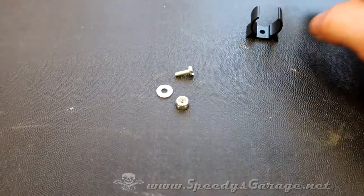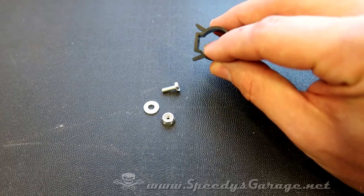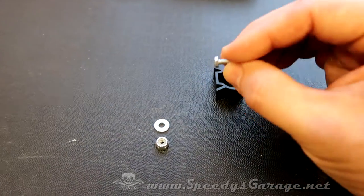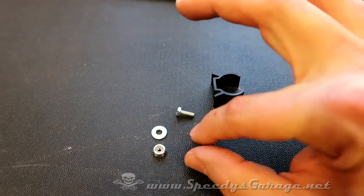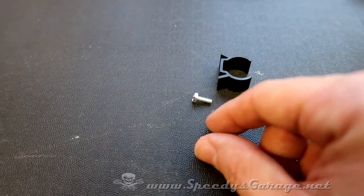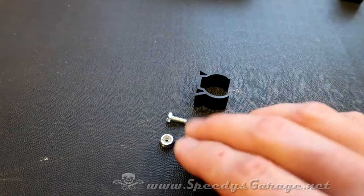I did pick up some hardware to mount it. The challenge is the mounting bracket has a very shallow spot for the bolt to pass through where the actual shift light housing will be. So I picked up a 6x32 machine screw, 3/8 inch in length, which should be plenty long, and it has a flat enough head that it won't contact the shift light housing when mounted. I also picked up a washer for the backside and a locking nylon nut to hold it all in place.